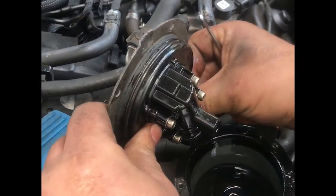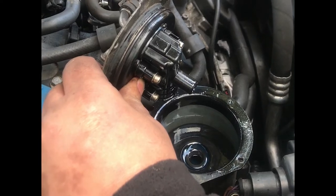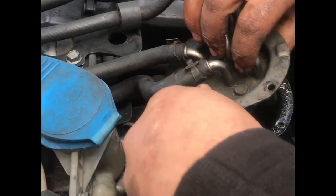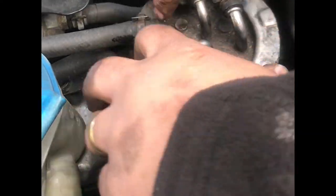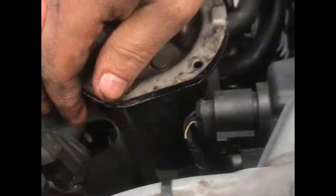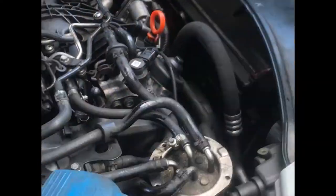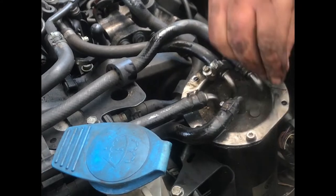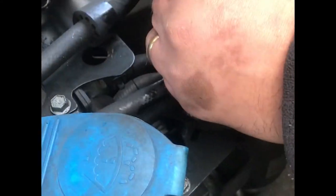Put the seal back in place — it's just a case of pushing it down firmly, and then you're going to feel that it sits in place, quite flat. Then tighten the 6 screws. No need to over-tighten.